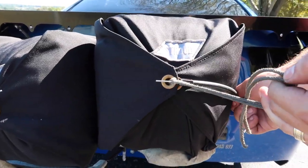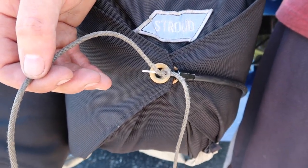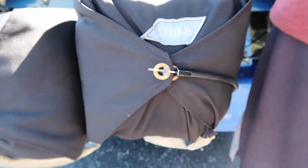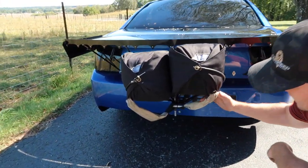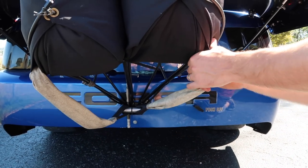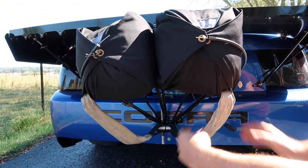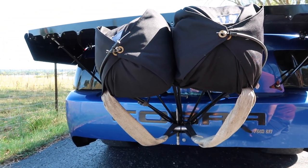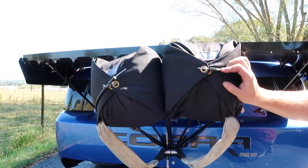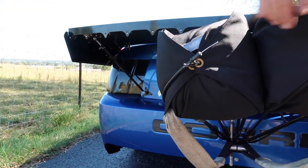So got the rope in there, and then the very last thing I always pull towards the end of the wire, so it's packed. So, see, the rope's a little bit tighter than the other side. So, usually just yank on it, try to get them even up, and then as far as the chutes go, we're ready. If we go to an eighth mile track, just pull this pin out and install this cable, and then both will be functioning.